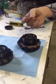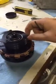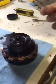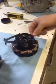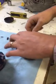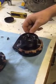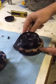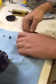Take a small screwdriver or an allen wrench that is able to fit into the cable securing screw hole. First take out the cable securing screw — you'll notice this is small enough that it can fit inside that hole. Now you can use this as a means to engage and disengage the clutch, and you'll notice that when you engage or disengage it, you're going to shift the friction discs so that they'll be free and able to drop into the slots. Simple as that.